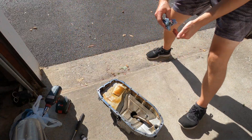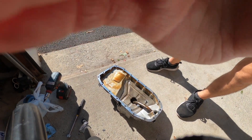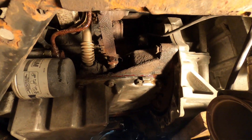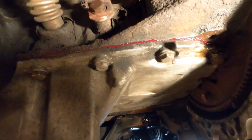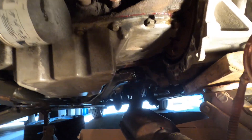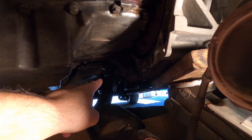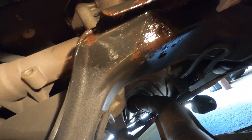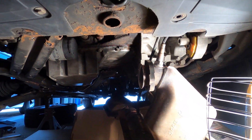All right guys, I'm going to go clean the underside of the car and put this back together. I think I did this whole thing in about an hour and a half — I'm not done, I just have to put the exhaust back up. But there you guys have it: a fresh seal on the pan, everything's nice and clean. The red Loctite-type gasket maker I'm using is the recommended high-heat temperature material — the last stuff I was using wasn't exactly this, so that's probably why we had a little issue. In one of the next upcoming episodes I'm going to be treating some rust under here with the rust converter, but I did a little bit up above the exhaust since I won't be pulling it down again. You can see it converting slowly, and then we'll put some paint over it.